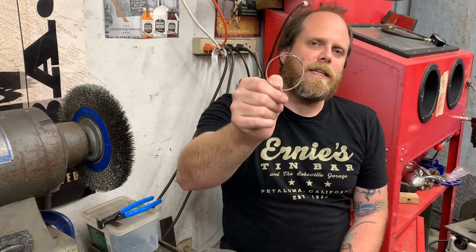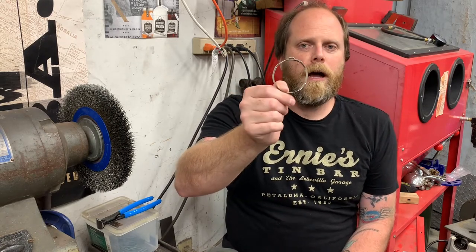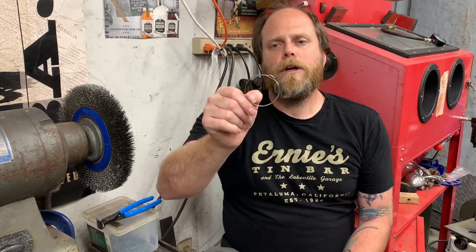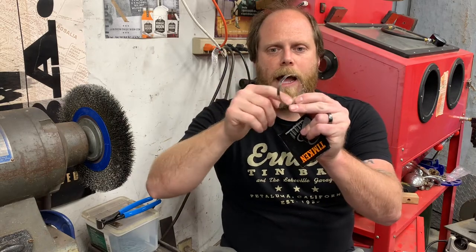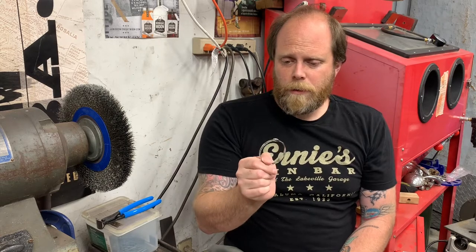This is a permanent style clamp used in many OE applications for plumbing. They provide a very secure seal, seamless on the inside, unlike a worm clamp. They're pretty cool. Why would you want to reuse one? Well, you certainly would not want to reuse an Oetiker clamp in any sort of critical application. Just replace it with a worm drive hose clamp and be done with it, right?